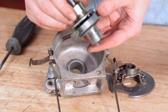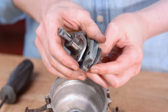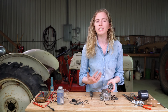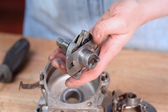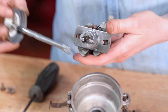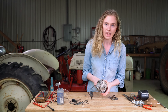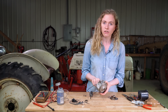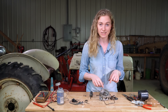Here is my gear and my dogs are here. Before you put yours back together, you should inspect these dogs. Make sure they move in and out freely like mine do, and look on the bottom side for any wear — that's probably the most common spot where they will wear and be damaged. If yours appears to be in good condition, you can go ahead and put it back in. Another thing to check is the bushing on the bottom. I'll put some anti-seize along the bottom here. When I set this into the bottom of the case, I want to make sure there's no play. This is really nice and tight so I can reuse these pieces. If you discover that yours has play at this bushing, you'll probably want to purchase a new case or a new distributor altogether, as that part is really essential.